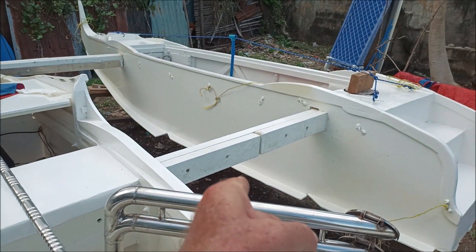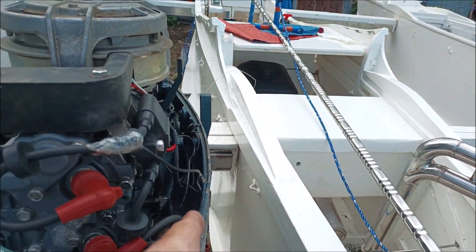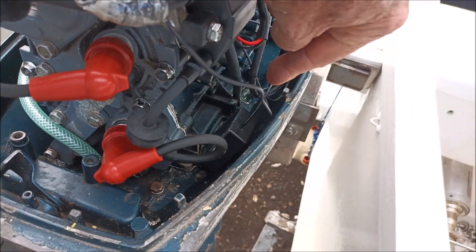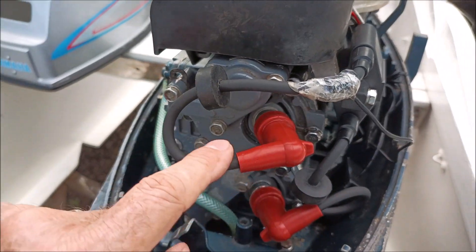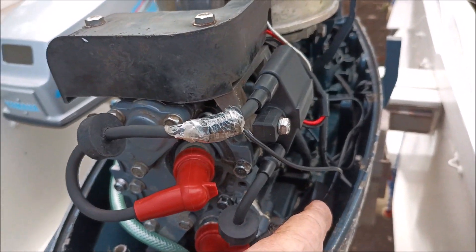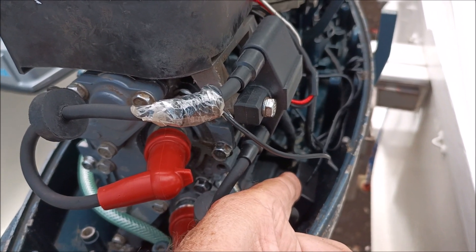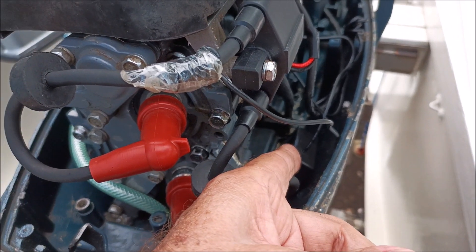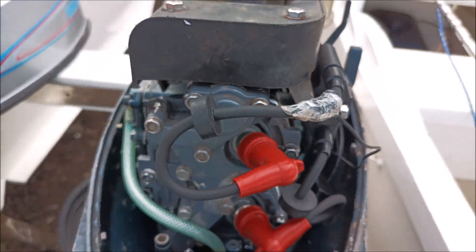There are little blue, red, and black ones that don't have any buttons — they're preset for a single-cylinder four-stroke or something like that. You'll get a double or half reading if you buy that style, so buy this adjustable style instead. Then waterproof silicone the back of it — not epoxy or anything hard — silicone just peels off when it's time to replace it.